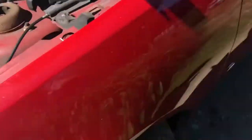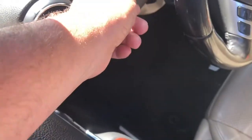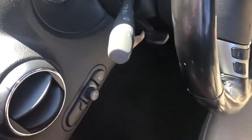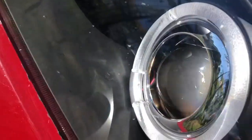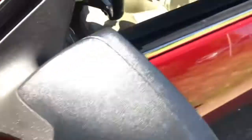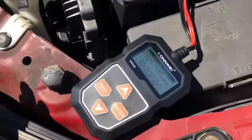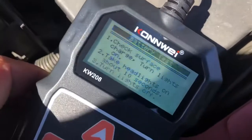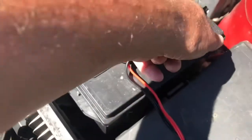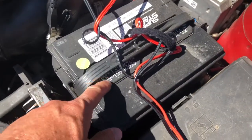That's surface charge. It wants you to hold for about 10 seconds. In the one we had at the shop, you had a long enough cord so you could hold it there and it would say 'turn headlights off.' This one is going to ask us to run headlights for 10 seconds. Make sure the headlights are on — yep. Then headlights off. Hit enter. Regular flooded battery selected, which means it's got fluid — water — in it. Those covers signify the battery type.